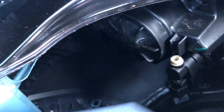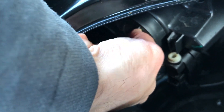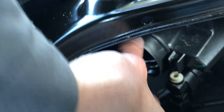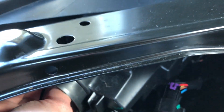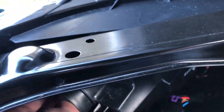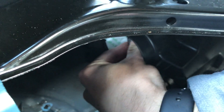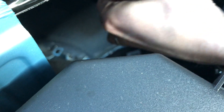So the back of the light bulb is this disc. All you do is turn that all the way around, then flick the cover off — and the cover comes off like this — giving you access to the back of the light. Then all you do on the light is twist it again, just twist it counterclockwise. And then, simple as that, just pull it out — you have access to the bulb.